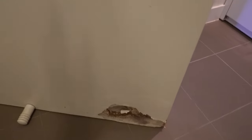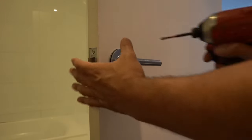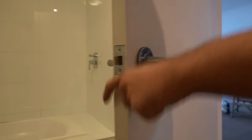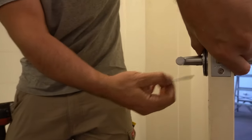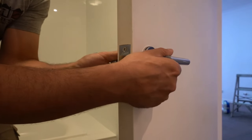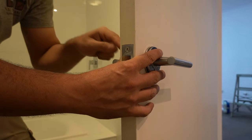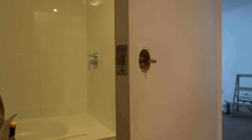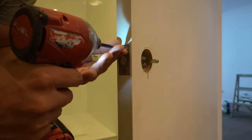The reason I'm pulling this door lock apart is because the door is actually water damaged and I'm about to replace the door, so the lock needs to come off. Remove our screws — make sure you don't lose those — do the same thing on the other side and pull the handle apart. This one here is a little bit tight because when it was painted they must have put the handle straight back on while the paint was still fresh and it's slightly sealed on. Set those aside and we can undo our two screws from the latch.